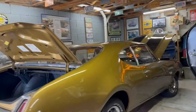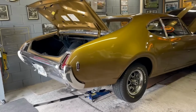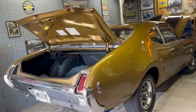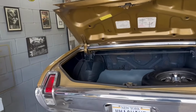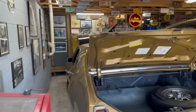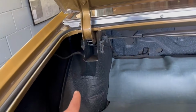But okay, that's it for the seasonal maintenance at this chapter. Really, everything else is just cleaning. It's kind of gotten front to back, top to bottom. I did plugs and points and condenser last year. I've had the plugs out, like I said before, with the carburetor. I took the plugs out and just kind of purged the cylinders. But lots of cleaning. This is what happens when you build two cars next to it. There's a lot of dust up in here I want to clean up.